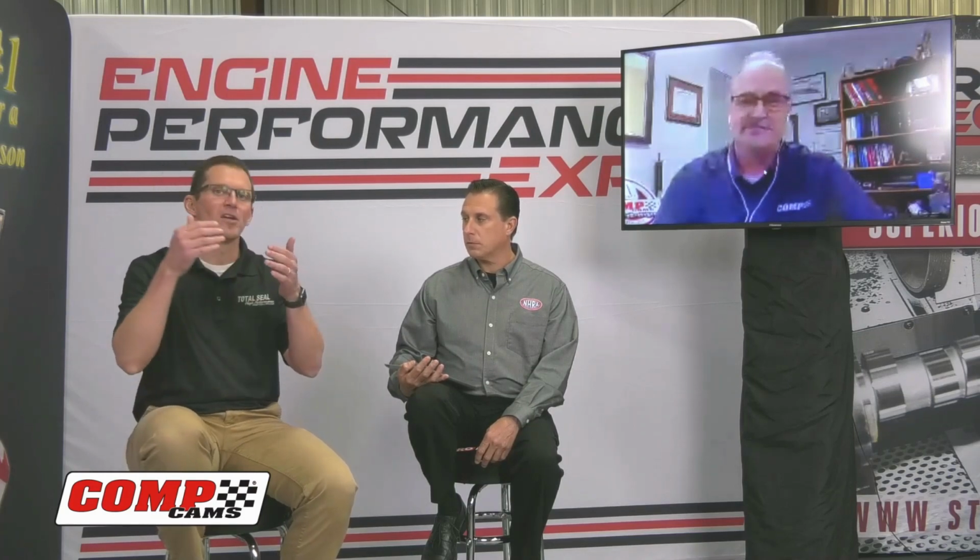I mean, Billy is the guy that taught me the word profilometer. That's been a big word the last 2 days. Surface finish. I mean, how many times have we talked about surface roughness, surface finish? Billy's the guy that taught me how to run a profilometer and what that means. And one of the things that Billy talked about in the past, I'm sure it was in the video, is that failures typically begin at a micro level, not a macro level. Put it in different terms, the failure you see on that part didn't begin at a level that you can see. It actually begins at a micro level that you can't see, and that's where the technology they have at COMP Cams with the profilometers comes in. That's what allows them to do things like the low shock lobe technology and the spintrons. It all comes out of the fact that they've got great resources, because they're passionate and committed to making power, making durable power, just like Ed said.